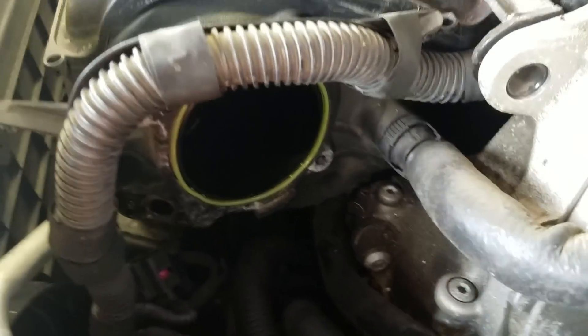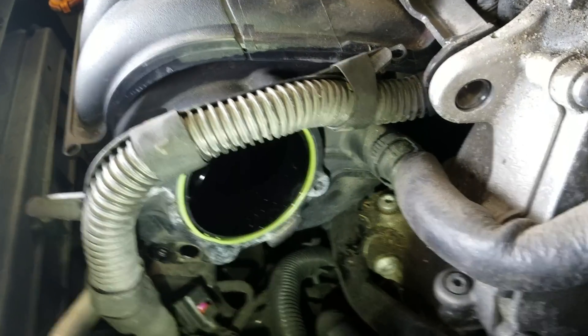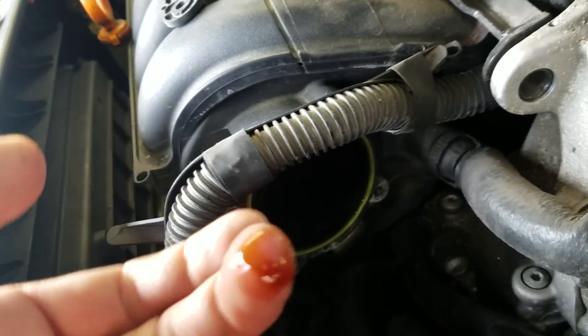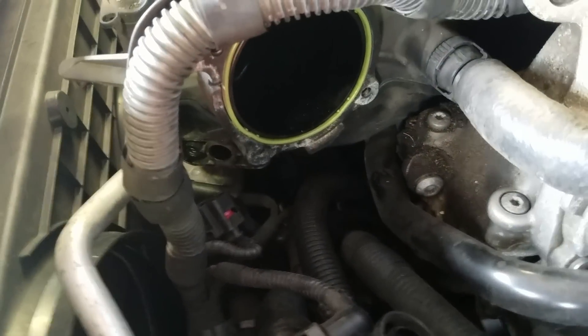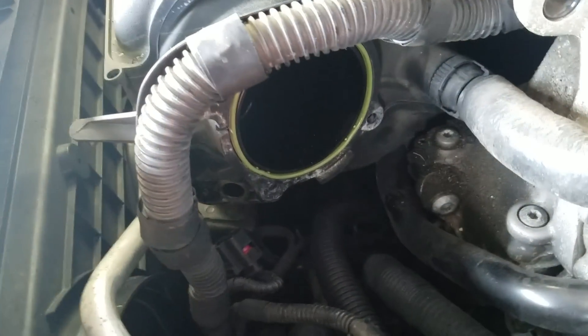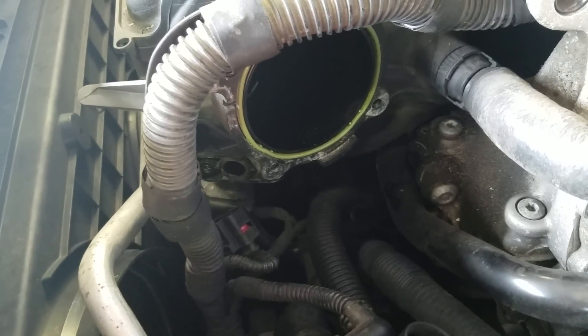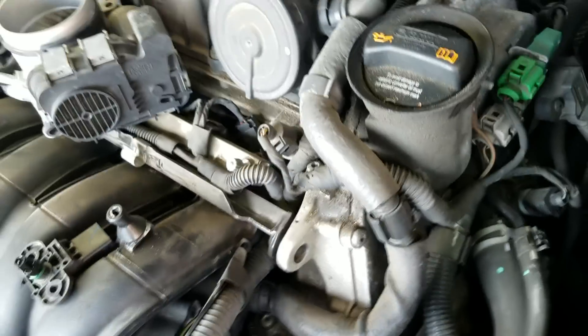When that valve starts leaking, you get oil passed into the intake. An easy trick even before you pull out that MAP sensor: stick your hand down in the intake hole where the throttle body used to be, swirl your finger around — if you pull up any oil, that's most likely the culprit. Oil gets down to the bottom where that MAP sensor sits, upside down, and gets coated in oil, messing with the signal the computer expects, triggering an implausible signal code.